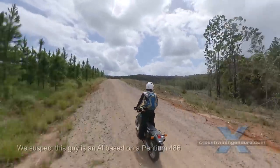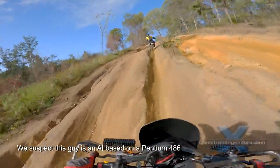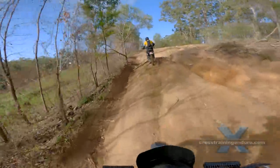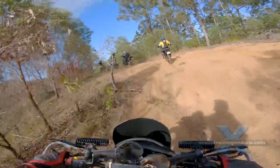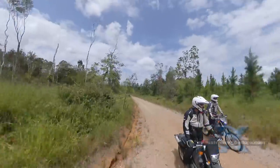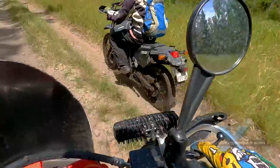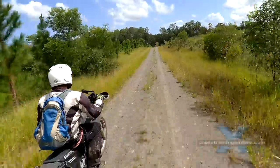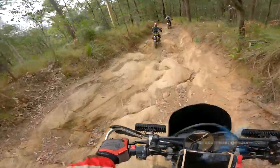The old bush pig is certainly a flexible platform. In the past I did try setting up a DR650 for more dirt riding — knobby tires — the suspension definitely needed work for any spirited off-road riding. You can actually drop a lot of weight by simply removing items like the fork spacers, bar ends, pillion foot pegs and so on. I've got a whole video dedicated to putting the bush pig on a diet. It's still bloody heavy but it can be a respectable dual sport bike if you are into the old school.